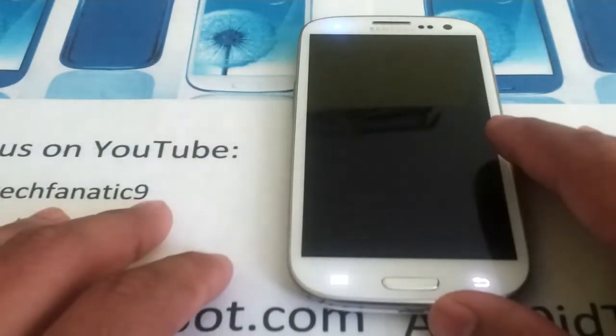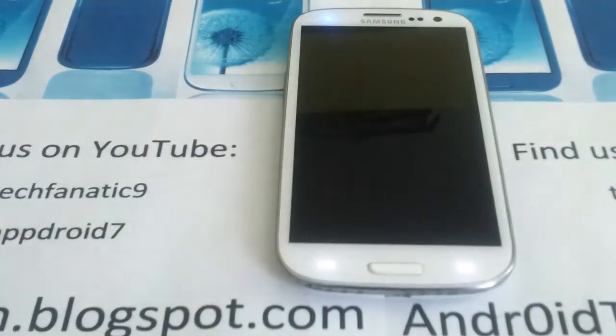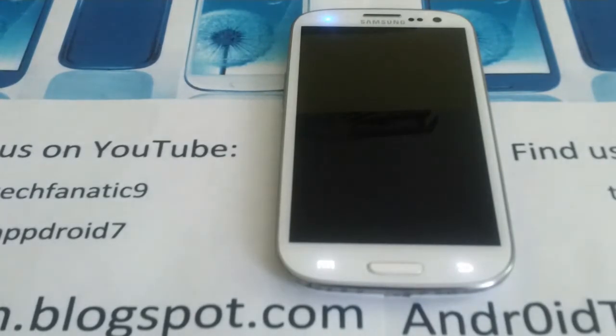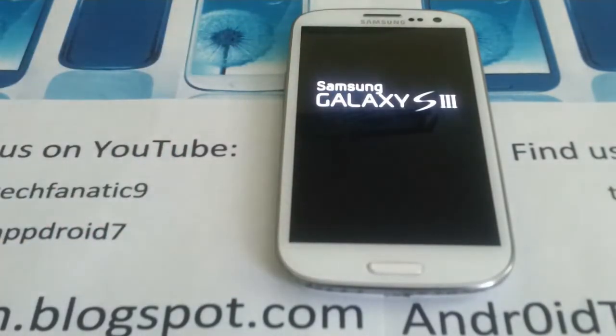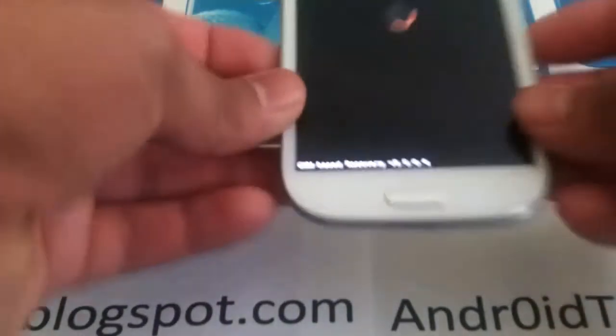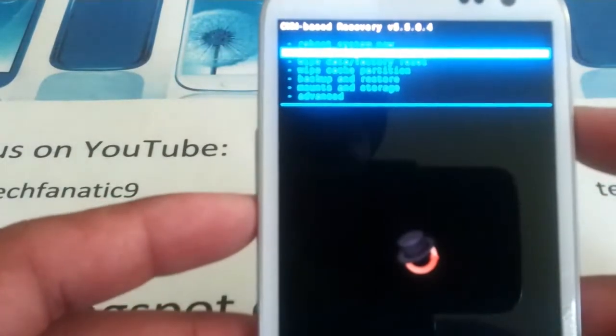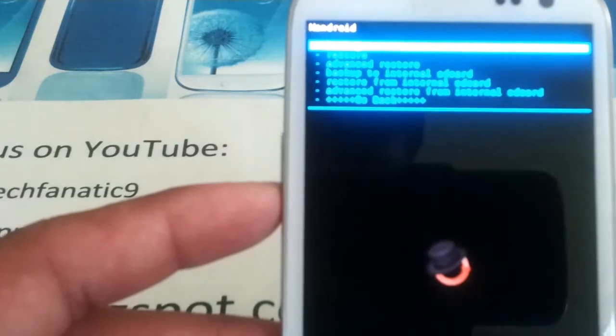Once the phone reboots into recovery, we are going to go ahead and back up our phone. Keep in mind, I am using ClockworkMod Recovery, so make sure you have that. If you have an S3, you will see that it says in blue recovery mode. From here, what you need to do is scroll down to backup and restore. Select that with your power button.